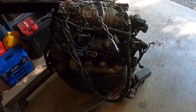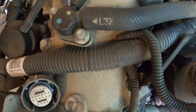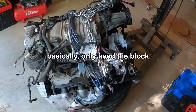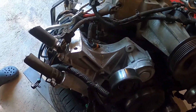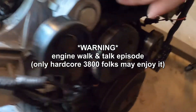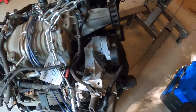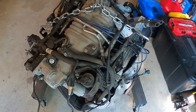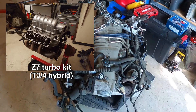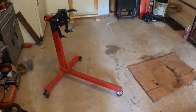Now that we got the engine here at the house, I'm going to start stripping off all the harness and all the brackets I don't need — everything on this L32 that is not necessary for building it up to go into the Regal. Definitely had some maintenance done at some point even though this is a lower mileage engine. The alternator bracket was changed out; it has the aluminum coolant elbows down here, which means it's had some maintenance done since this is an '04 engine and those came out in 2012 from Dorman. I'm going to go through and get everything ready on this. I might even mock up my old turbo kit on here just to take some photos for the classifieds, but other than that it's going on that engine stand and I'm going to put it to work.